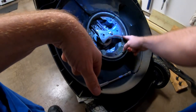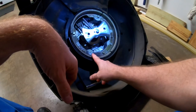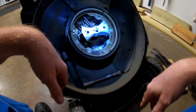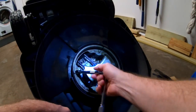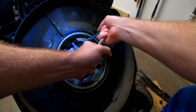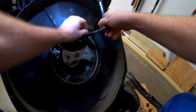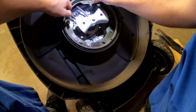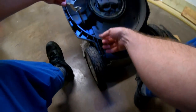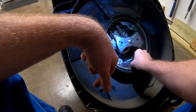The next thing you want to take out is these bolts here — these are 12 millimeter. This one you don't have to take out because it's not on these plates. You're going to find that two of these bolts — the two I'm on right now — are longer than all the rest. I don't think you can screw that up because these longer bolts can only go in one spot. The other bolts are short.